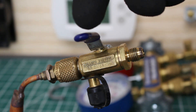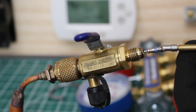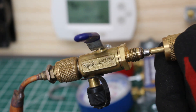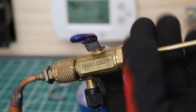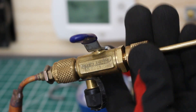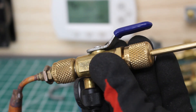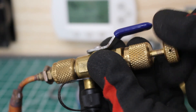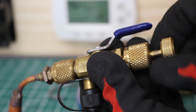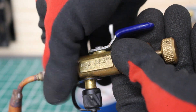Right now, we have the valve closed. Let's say this is a new pin — a new Schrader valve. What we're going to do is push that in, go here, and close this up. Open this back up, because you're not going to be able to slide back in otherwise. Slide back in and install your valve once again. It's a snug fit — and we're done. Now we can open this back up, and the pin is in there.